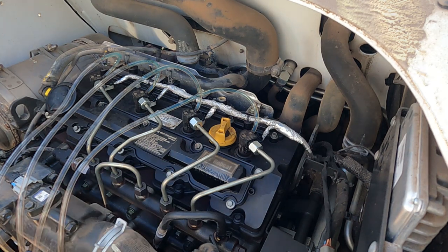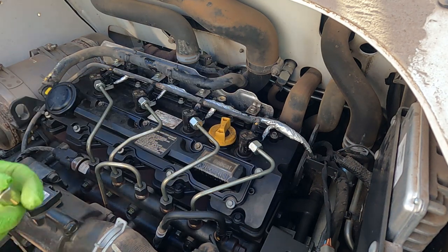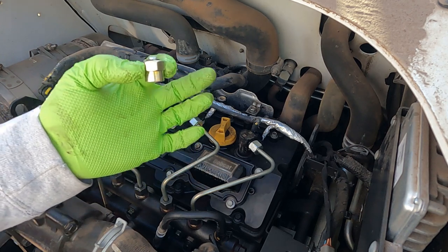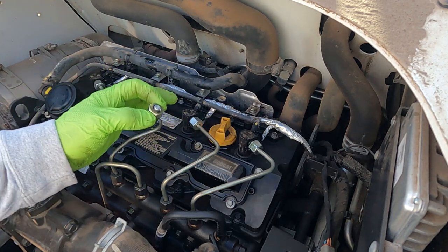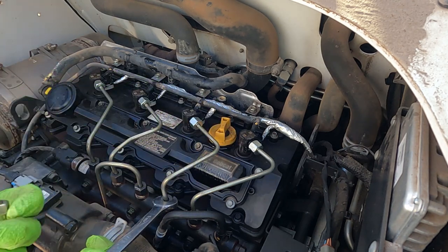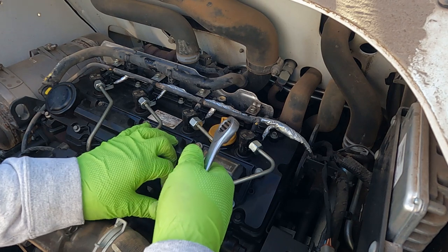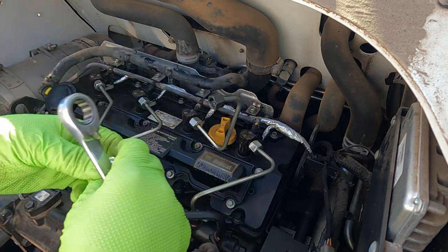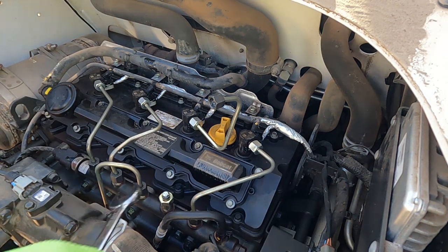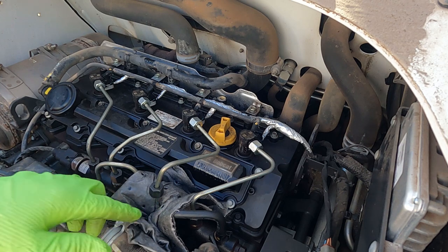I'm going to show you a little trick here. I went ahead and removed my clear tubes and put my return manifold back on the injectors. What I have here is a little cap — an injector block-off cap. I'll show you where you can get this in the description. What I want to do is cap off the rail right here for number two, isolate this number two injector, and hopefully that'll give me enough rail pressure to fire the other three injectors. I'm going to get this line out of the way and put my cap on the rail. Now that I have the number two injector blocked off at the rail, let's see if she'll start.